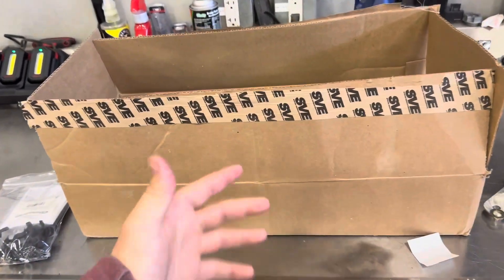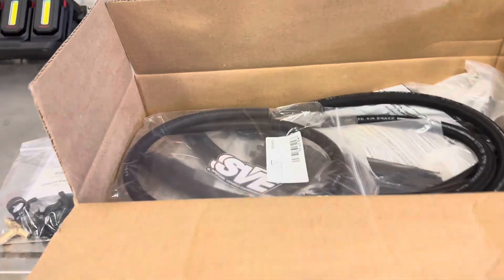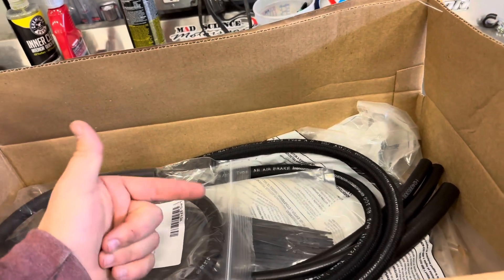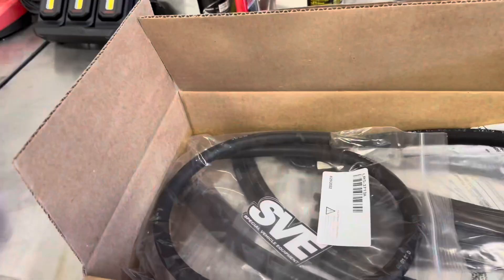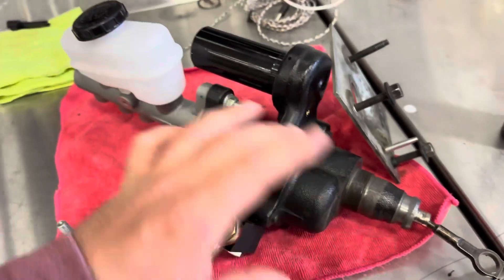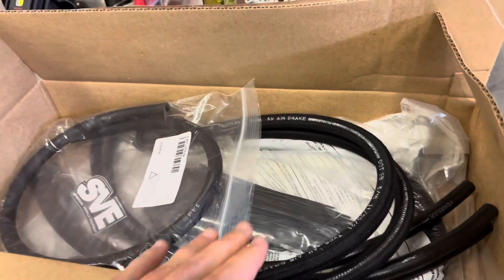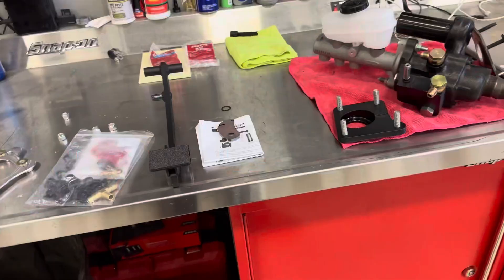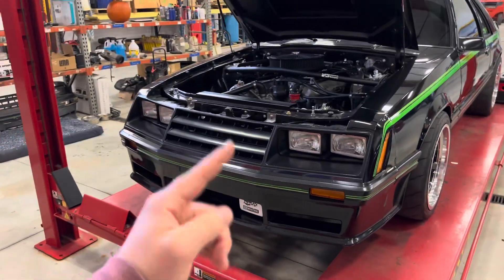In this box it's SVE's brand for all the lines and everything. I will say this kit is for a coyote swap, a Power by the Hour speed drive setup, however you can use this with a small block Ford. Everything for the lines is the same as long as you have a fox body rack — 87 to 93. I'd highly recommend putting an 87 to 93 power steering pump in it. It includes lines, fittings, hoses for the hydro boost. There are zero videos out on the Maximum Motorsports kit, so I'm happy to be working with them to bring you guys this video.